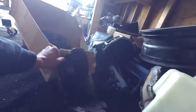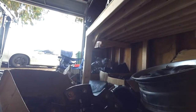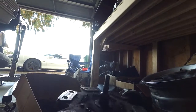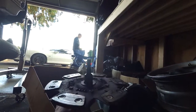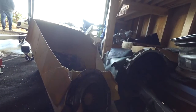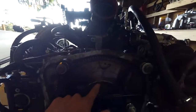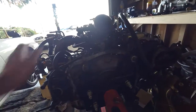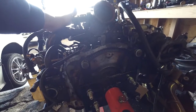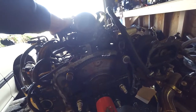This is my ceramic 6-puck clutch that I was running, and I've always hated it because it shakes the whole car and chatters like crazy. I was planning on reusing it since I'll be making quite a bit more power and this clutch is already overkill, but there are tons of grooves in the pressure plate and the flywheel is just as bad — tons of material taken out. So I'm going to go ahead and get a new clutch setup. I'm considering an 06-14 WRX flywheel and clutch, like a stage 2, so I don't have to go ceramic.